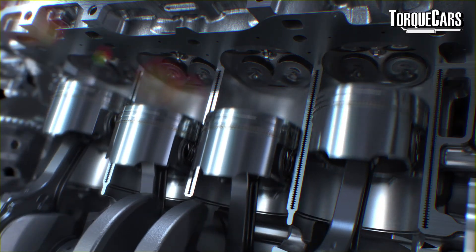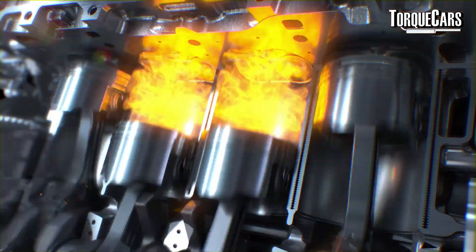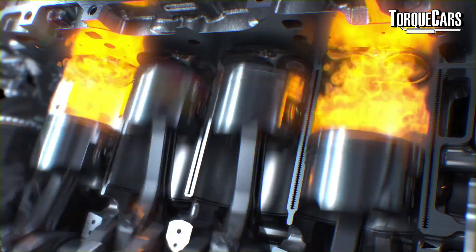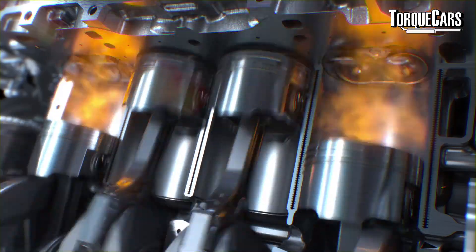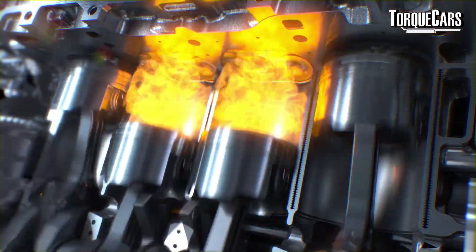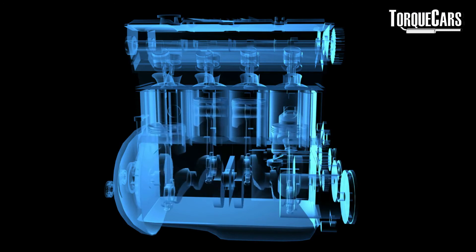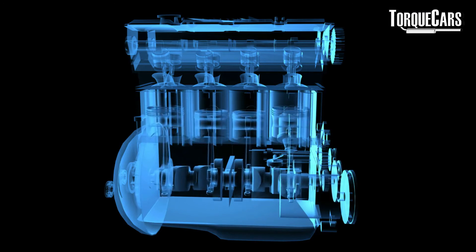Iridium plugs have generally been proven to perform better — you get more power, a cleaner spark, and it starts the burn cycle much more easily. How does the spark plug affect the flame front within the combustion chamber? The smaller the gap, the better for combustion — especially for high-injection pressurized engines — though this can result in self-ignition which can actually damage the engine. The larger the gap, the more prone to misfire and the less efficient at igniting the fuel. High-pressure injection systems give a much smoother flame front, so the combination of spark and injection pressure must be taken into account.